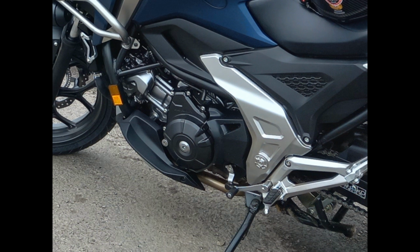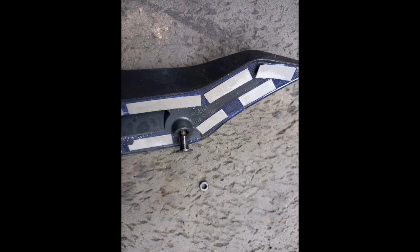One thing I will say, though, is the way they're fitted. When I got back from the trip, the bike was absolutely covered in muck, so I was giving it a wash, and after I wash it, I use some anti-corrosion spray. While down there spraying the anti-corrosion stuff, I put my hand onto one of those foot deflectors to lever myself up a little bit, and it came away from where it's joined. You'll see in the picture there, the way it's fixed is with a single bolt that goes through into the bike at the lower end, and sticky pads that stick it to the plastic undershield of the main bike. My fault, obviously, I put my hand on there and used it to lever up. I thought it was more secure than it was, and that pulled it away. So it was a really, really easy fix. I just got some more double-sided pads, took the bolt out, repositioned it, bolted it all back, and it's been perfect since then. And now I know not to use it as a handrail to get up.